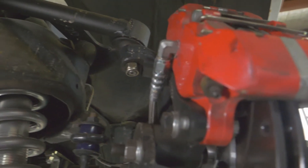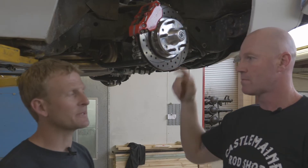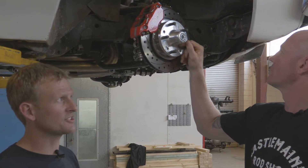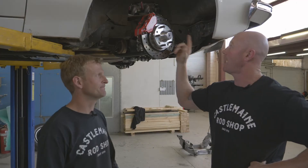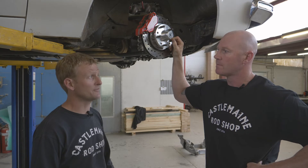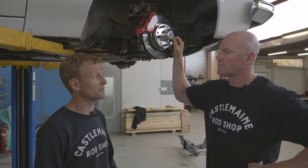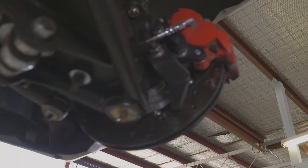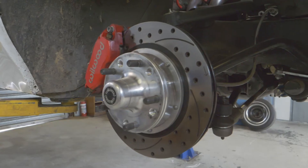How long roughly to put these on? I would allow your average mechanic a couple of hours. There's no angle grinder, no oxy needed — it's a spanner-off, spanner-on job. And brake lines? They are another issue. We do have them on the shelf — ADR-approved, and that's very important. If you are going to make your own brake lines, stick to the ADR-approved ones. So you bolt these on, put the brake lines on, bleed the brakes, and away you go. All done — simple as that.